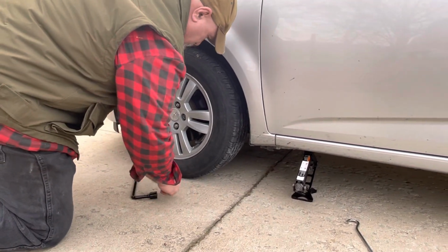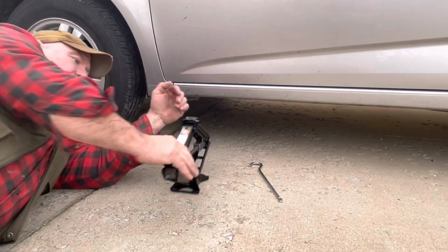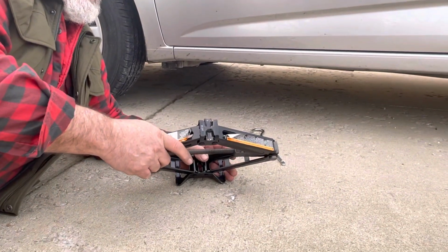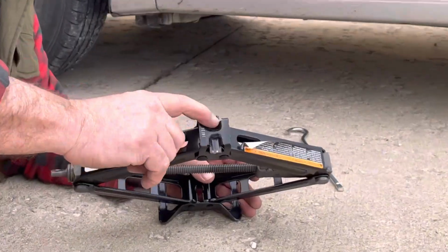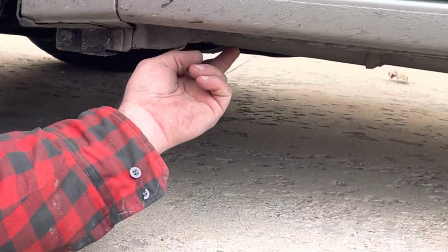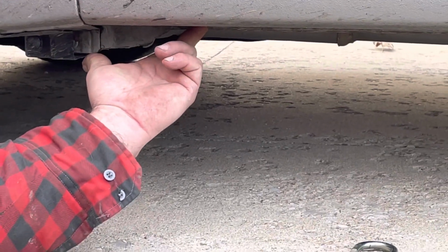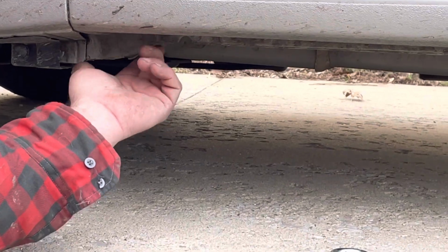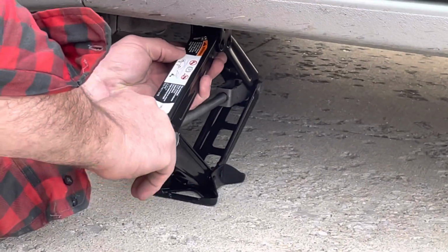And then we come down here to the jack. And this is very important. This is just a little scissor jack, which is typical of what you find in most vehicles today. They just screw up and screw down with this little screw here. But if you look in the top, you see this little hump right here, right in the middle. And if you go underneath the car, right here, I don't know if you can see it, that little hump jives with this little divot that's right here. You have a place where your two body panels come together there, so it's double thickness of steel, it's spot welded, it's very sturdy. Doesn't necessarily look like it, but it is. And that is where that jack goes.